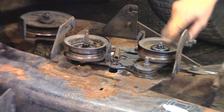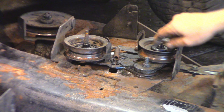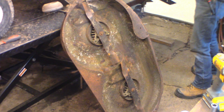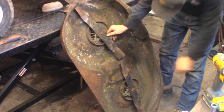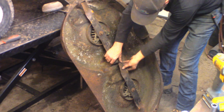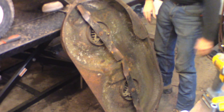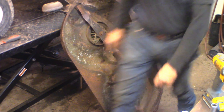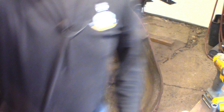Still got to replace this — I don't have one, I'll order one. The deck is flipped down. I'm going to order that pulley because I didn't have one in stock — I'll change it later. Let's do a quick blade inspection. They're on the right way — that's a bonus. I'm lining them up so the tips are pointing together, making sure they're even on both sides. They are even, so that tells me the blades aren't bent and the deck is straight. The deck's in good shape — it was pretty clean actually. I'll oil spray that after I paint it.